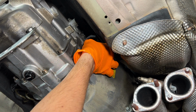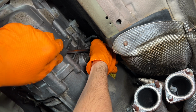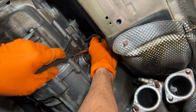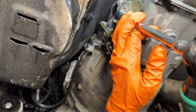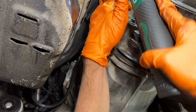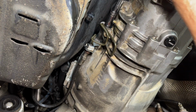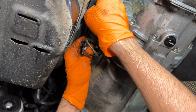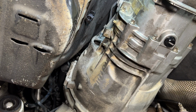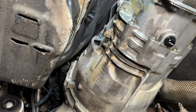First thing we're gonna wanna do is we're gonna pop this transmission sensor out. This is for, I think, reverse gear or something. Yeah, and then it goes up and over. Next up, we have 2 13s for the clutch slave cylinder. There's one. Let's see how I can get this one out. There we go. So just get that up and out of the way. You can see now the 2 studs that are right there. Just gonna let this hang on my control arm out here.